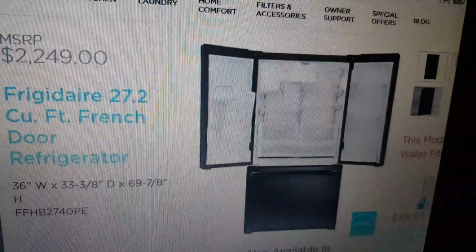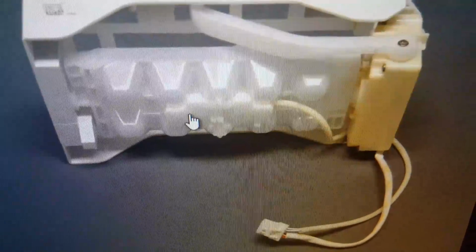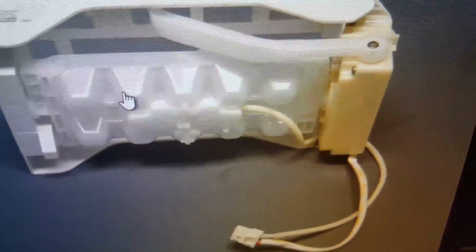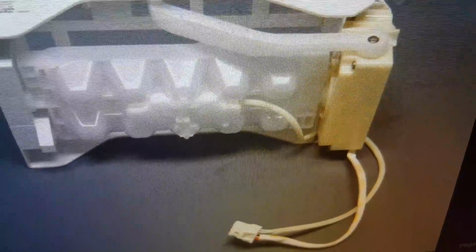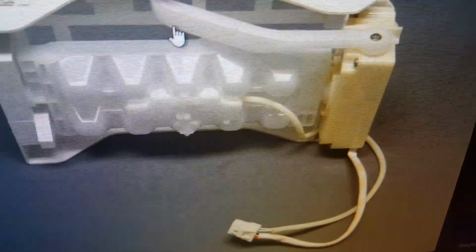And on these ice makers, you also have a sensor that detects whenever the ice is made on the cubes, and usually once ice is made, it's gonna go to the harvest mode, in which this tray would spin, drop the ice, and then more water's gonna come in to start a new batch.